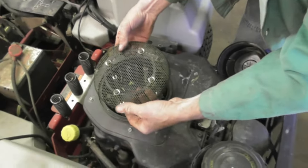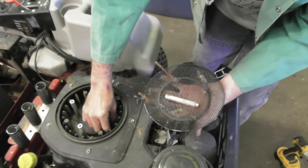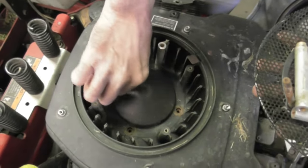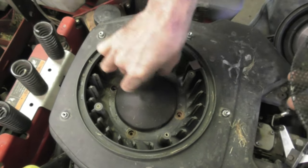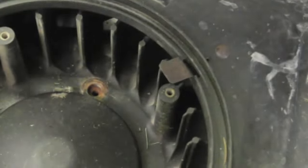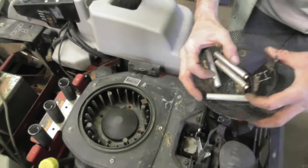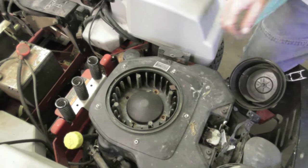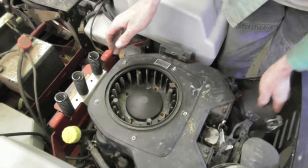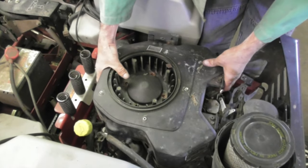It's nice having one of these battery power tools, makes it faster. Lift these off. Now these little things come off with it and they got little spring washers under there, so make sure you don't lose them. That little metal tab - when that screen is spinning it's supposed to clear the grass away from the screen and keep it clean. That's what that little metal tab does. All right, got all the bolts out so we can lift the cover off and expose the coil.